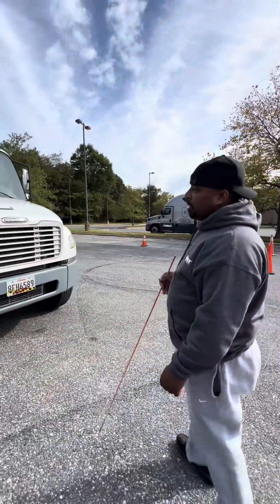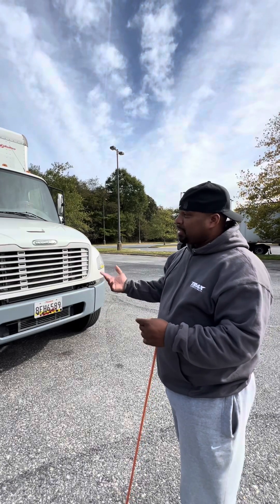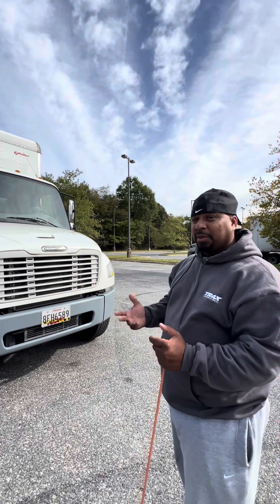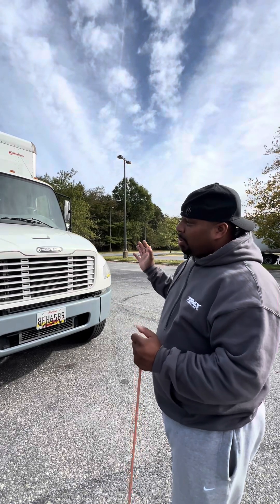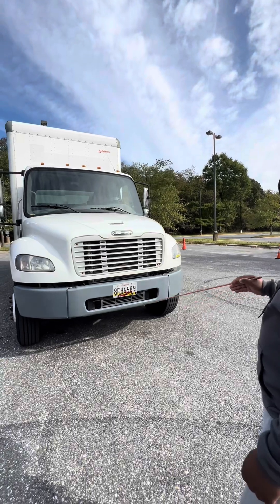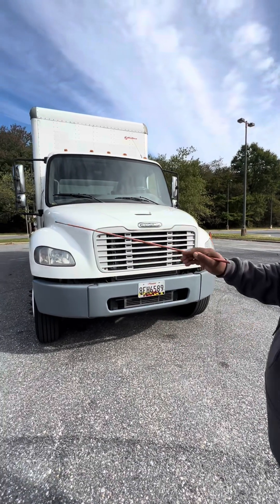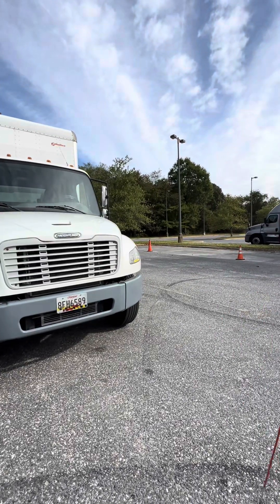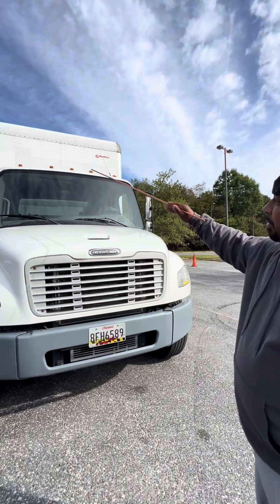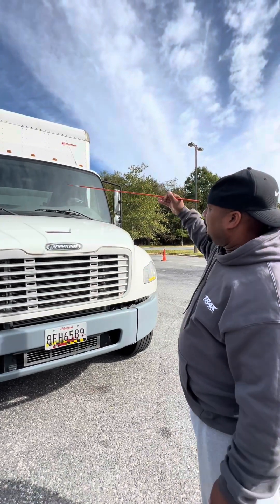On my outside inspection, just remember when you do this test, you're having a one-on-one conversation with the instructor except you're doing all the talking — they're just listening to everything you say. Any good instructor can tell if you know this stuff or if you're just trying to skate through it. So just talk like you're having a regular conversation. As I stand in front of the vehicle, I want to make sure the vehicle is sitting level — not leaning from one side to the other. If it was leaning, it could be an indication of a flat tire or damaged suspension. I'll look down both sides of the vehicle to make sure there are no obstacles or obstructions on either side.